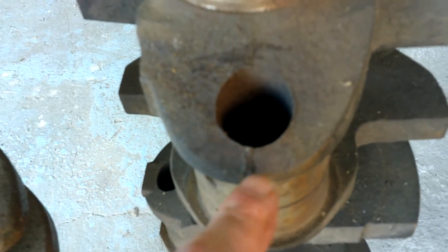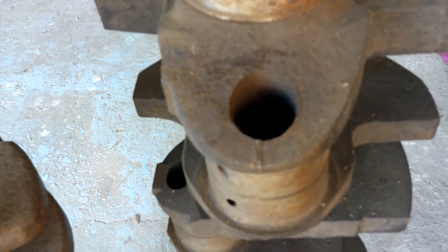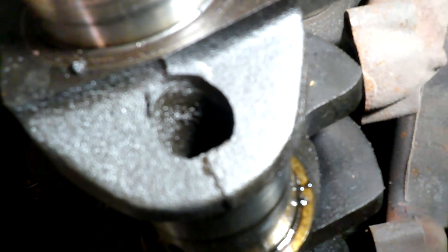That's usually how you can tell on a forged crank. Just for a quick comparison, over here you'll see a skinny one, but that's a Chevrolet. So let's walk over and compare it to another Mopar crank. This is a 400 crankshaft — the other one's a 383. A 383 and a 400 is basically the same size block, not a raised block. You can basically see this skinny line — see how skinny this knit line is? It's just like a little line, and that's where the two halves came together. That is how you tell the difference.